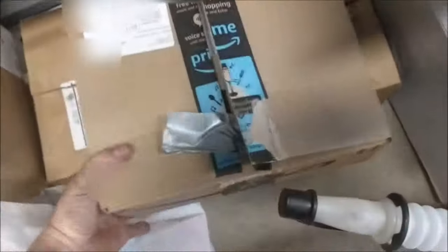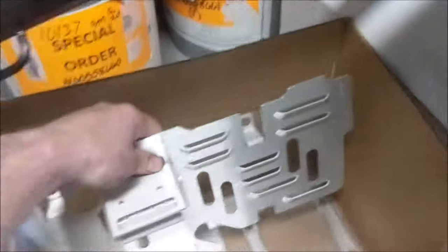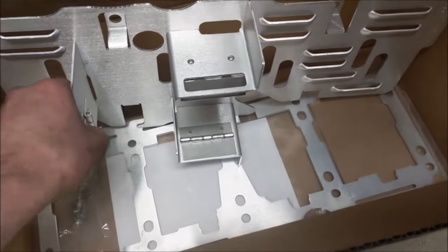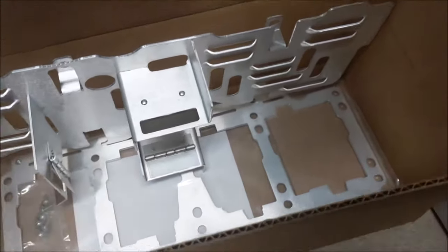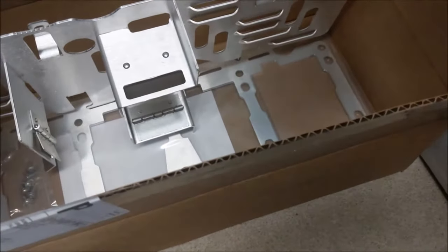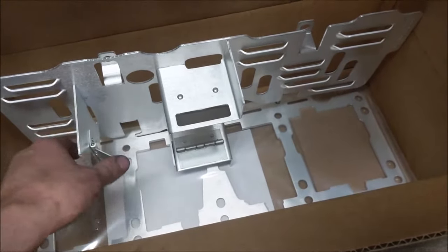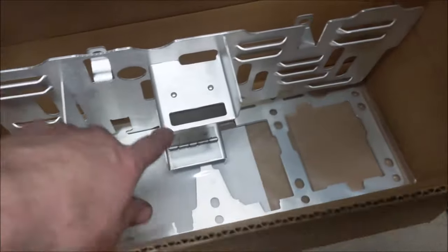He actually found this fancy windage tray. I don't know if I'll find it easy enough here. There it is. I guess this is supposed to reduce engine friction by directing the air better. You can see it's got those baffles in there. These are like little one-way baffle things, and they're supposed to coincide with the pan itself. This is like a crank scraper slash windage tray. These baffles scrape the crank clean as close as they can without actually hitting it. It's supposed to fit that stroke. And then these are to keep the oil where the pump actually sumps from, which is right here. There are baffles in the pan already, and they have holes in them, so I think this is supposed to coincide with it. Go look at the pan quick.